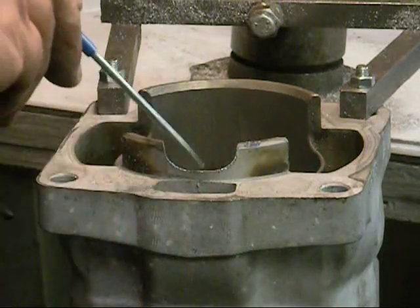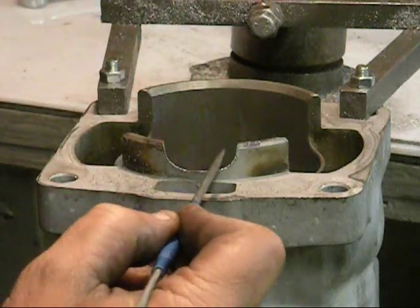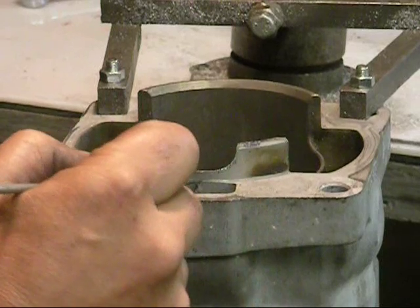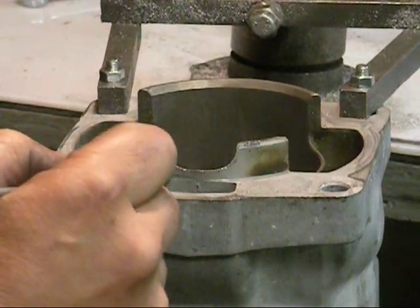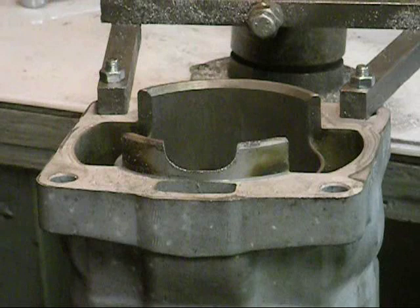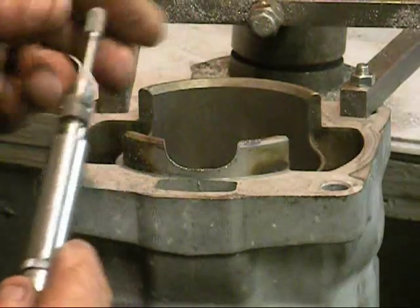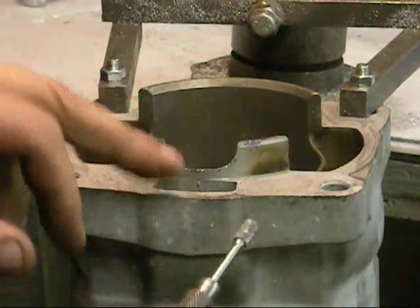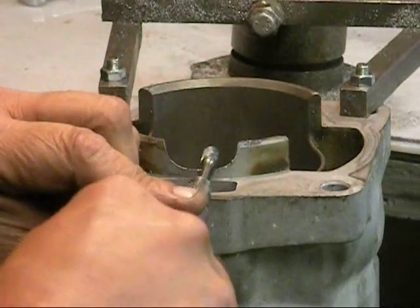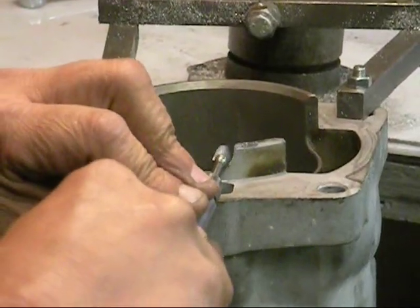You can't really see on the other side, but the line that was scribed — that I ground to — it's perfectly level with this. So what I'm going to do, looking from the inside, is use my grinder, come down, and cut this equal to the base of this part, then round it off into the boost port. I'm going to use a single cut carbide burr for this, and one thing you really want to be careful of is not to touch this gasket surface. I'm checking to make sure the chuck isn't going to come in contact with the cylinder, and then we're just going to start grinding it.